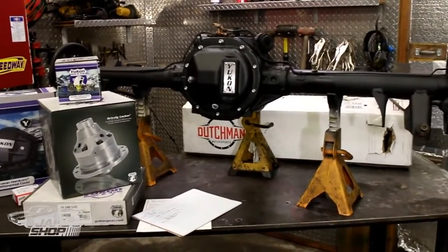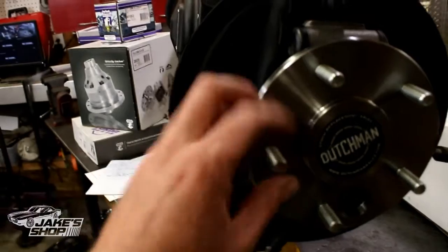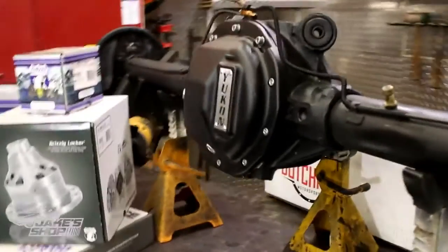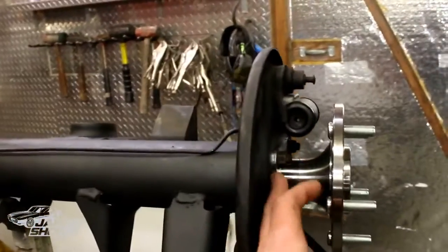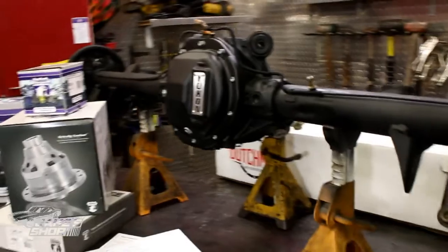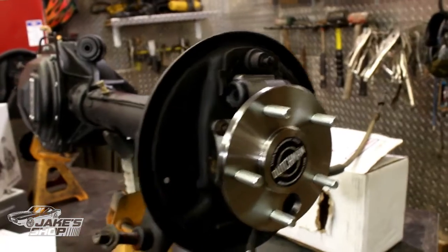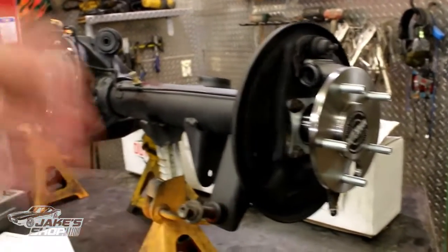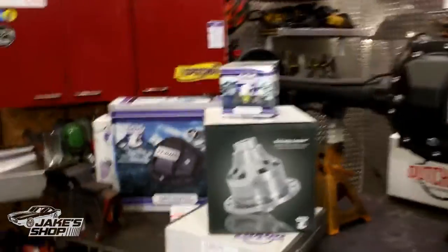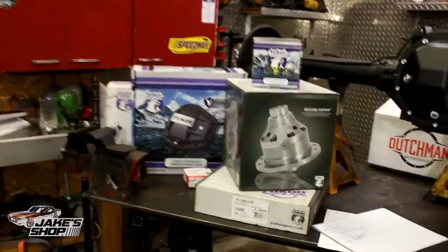The one downside with an Oldsmobile are the axles. These axles were custom built by Dutchman — this is actually their stock replacement axles, they still build them. You have to give them the exact info to verify because there are different bearings in these end housings depending on the year of the car, and assuming you've got the stock axle under the car. It's a bunch of stuff you want to check before you go have a very expensive set of axles made. These are at least 25% stronger than stock. Being that they're a 30 spline, they're even stronger than they would have been if they were the 28 spline that came in this housing initially. That's why it's really tricky with parts and why you want to talk with a good company that deals in those parts.